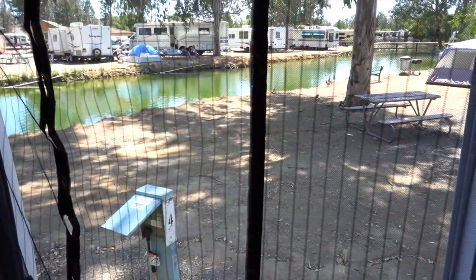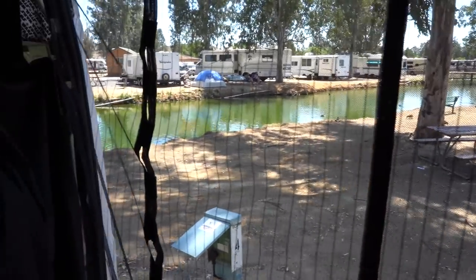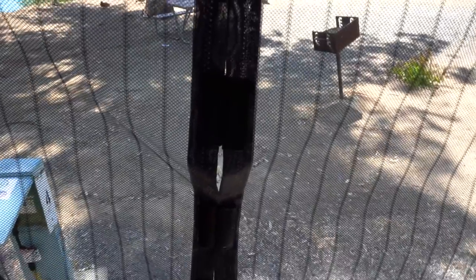On these back walls, we have covered more of the rigid insulation board in order to help with the temperature in here. And our door is slid open, but we've done the same thing on the panels of our sliding door. So that we can have our door open, we have this screen mesh. We actually purchased this. It is a kit, but we kind of turned it into how it would work for us. We bought two kits, sewed them together along this edge here, and cut off the extra over here. We have screwed them into the plywood that's on this side of our van, and then it has magnets down the middle so that we can go in and out, but this keeps any bugs out and allows us to let some fresh air come in, which is wonderful.